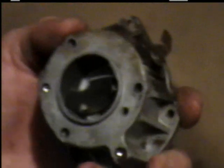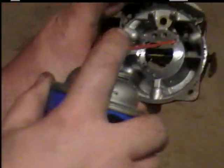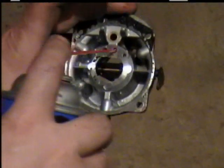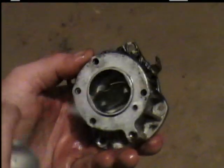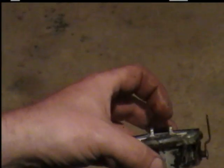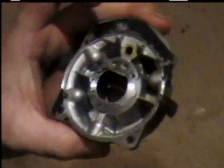And look down in here and see if you see any holes. That's why it's best to do it in broad daylight. And after you do that, spray your carburetor cleaner back in it. Make sure you get all the holes poked out. Okay, that's all for now.